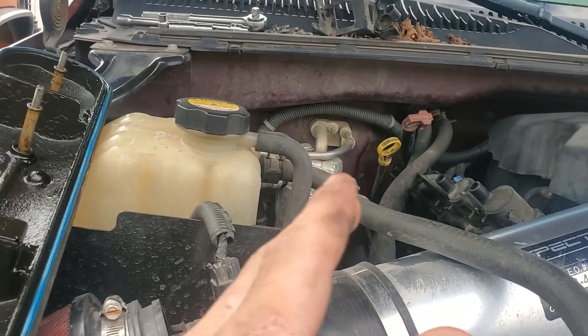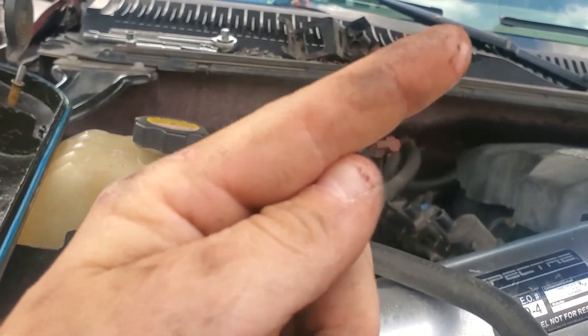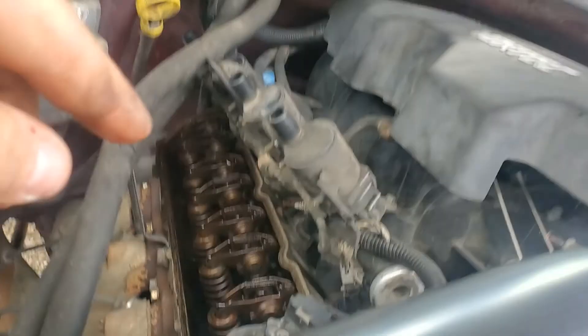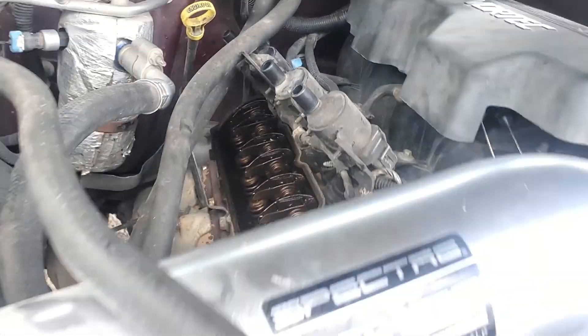For instance, there was this one instance that I was driving to Table Rock — you guys have seen this video, or if you haven't, go check that out, I'll put a link to it. One of my rocker arm bolts — those right there — they failed. And when I say they failed, I mean it completely loosened up, because they're torqued to yield, one-time use. You should really get new ones if you're gonna take them off. I didn't — stupid me, I still haven't gotten a new set — and it completely backed out and killed a cylinder.